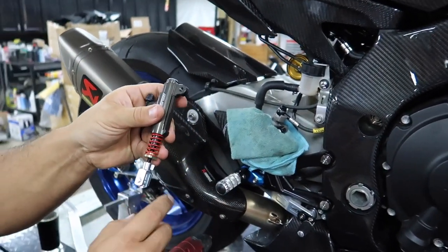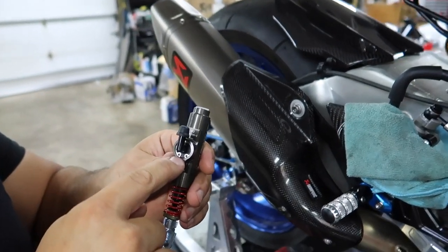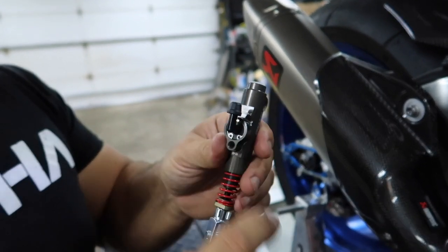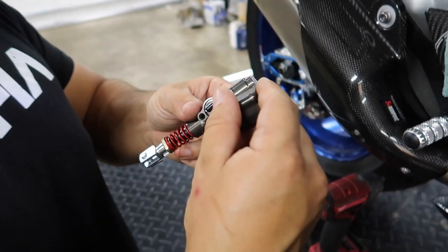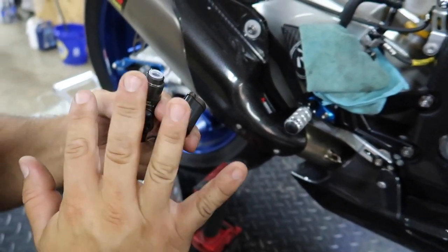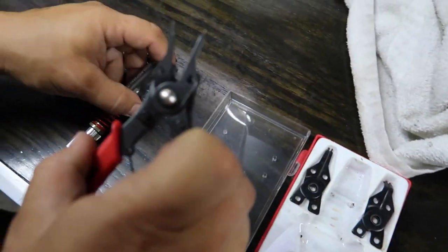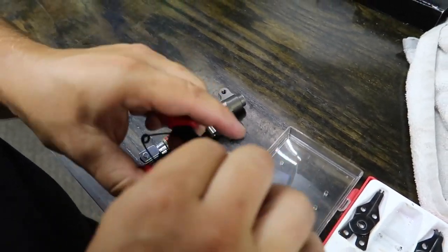Spring's done. Kind of just loosely put this on there. We have to remove that retainer ring. Then we take this piece out, and there's an O-ring that goes on this surface, right in there. Then there's a bolt that holds everything together. So let's assemble this whole piece. I'm going to be using this snap ring plier set — there are specialty tools for everything. This one comes with different heads.